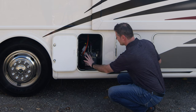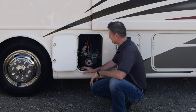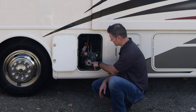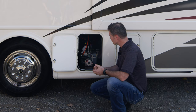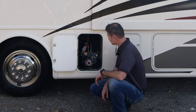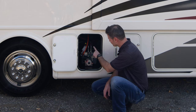This is an important bay to note — this is the hydraulic setup for your one-touch leveling jacks. We'll show you how to use those when you go inside. It's important to level your coach before you put out your slide walls. You have your reservoir in the back here. In the event you would need to manually retract your jacks, it's easy to do: loosen a couple of valves, take off the black cap, and use the right chuck with a cordless drill or screwdriver. After loosening up and following the clearly labeled instructions, zip them right up, put the cap back on, lock up the valves, and you're good to go. We have a complete video on this in the description below.